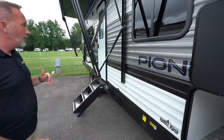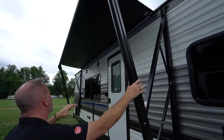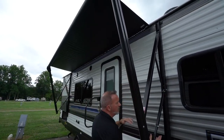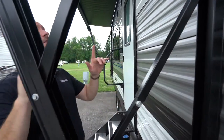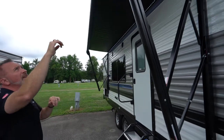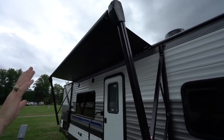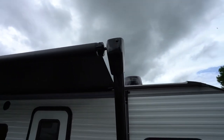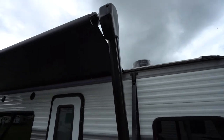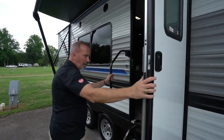If you do need to get some true leveling, put some blocks under there so that you can level. These do come with the Solera power awning with adjustable pitch. You'll notice the arm here — you can pull it down to adjust the pitch when it is fully extended. With the awning, there's a little rubber nozzle up there with a 7/16-inch bit on the inside. If your awning does not work with the rocker switches, you pop that little nozzle out and control it manually using a power tool or your hand crank.